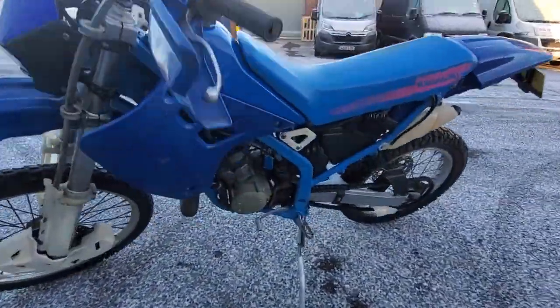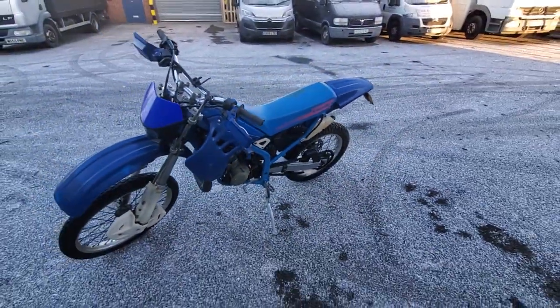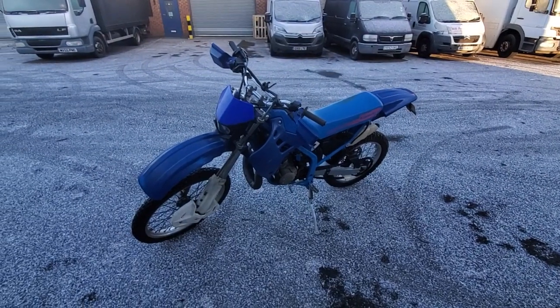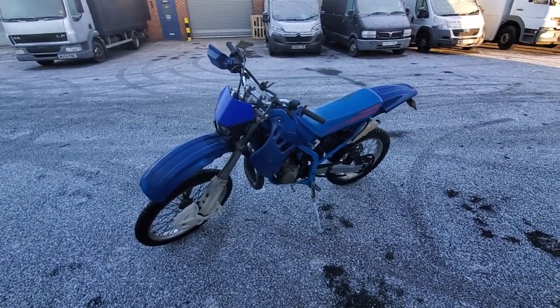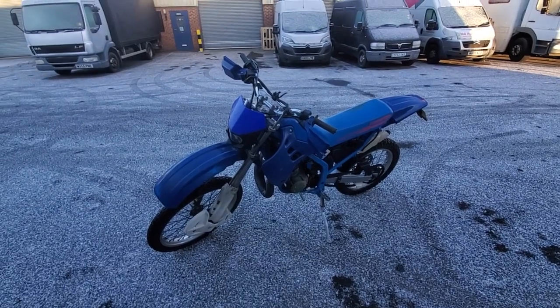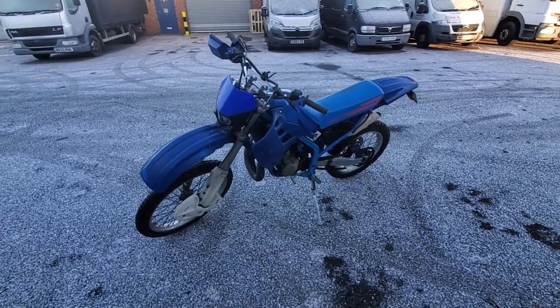There are probably a few jobs and bits and pieces the owner is still going to do to it. But yeah, it's a good little bike now. With the Ignitec ignition unit we've put on, it's a programmable ignition, so if he ever wants to, he can always play with the advance curve and try to get a little bit more power — though I don't think that's really what this bike is aiming for.